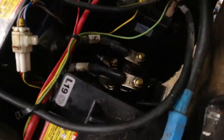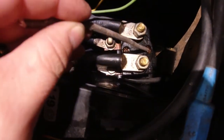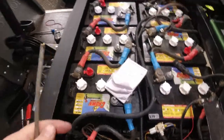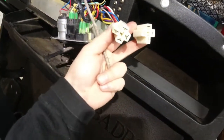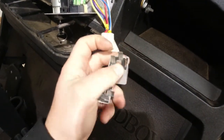As far as the solenoids go, I took my voltmeter on continuity and went from that rusty screw to this one, and eventually after wiggling around I did get continuity. Then I pulled this out and found these two connectors with relays connected to them. I got an ohms reading on one but not the other, so that told me to go find some new ones.